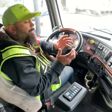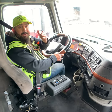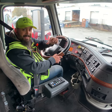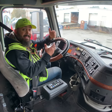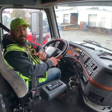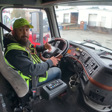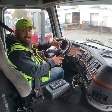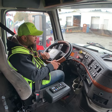I have to explain to you three times. We have to say low air warning, low air warning, low air warning. One time for the test name, low air warning test. Second time for the explanation, the low air warning light or buzzer should come on at or above 55 psi. And the last one for the result. When you pump and you see that, you have to say the low air warning light, and if you hear the buzzer too, and buzzer came on at 55 psi, it's working properly, the truck passed the test.